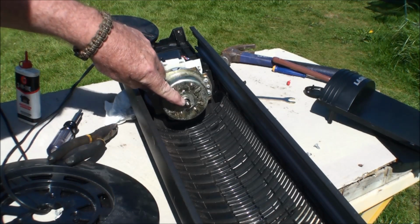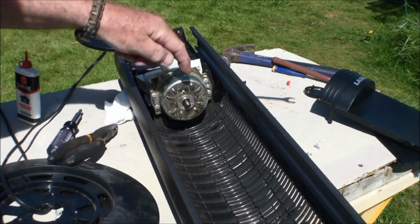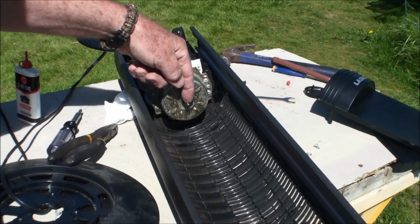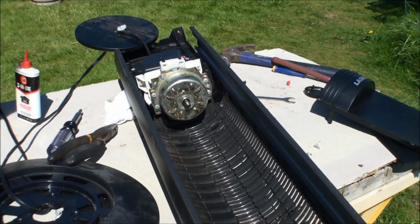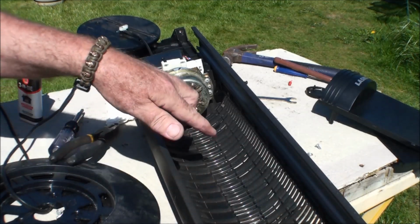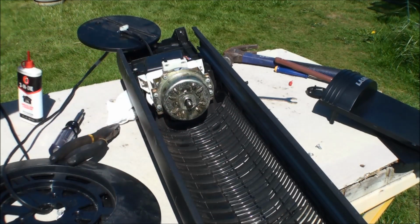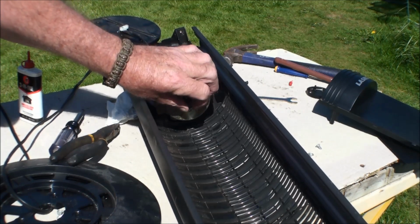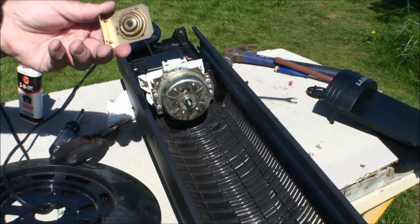And on here, the shaft has got a cutout on it. When you're installing the fan, you've got to make sure that the screw that's on the fan will be able to catch in there and snug it in there, and that locks it in so it'll stay twirling like it's supposed to. And I'll show you that as I'm putting it together, but for right now, I'm going to go ahead and take a brush and brush this inside because I didn't take this in the house. It doesn't look that dirty, but you wouldn't believe what comes out of a fan after it's run for 1 or 2 years or more, until the motor wants to slow so far down that you think it's burned up. So anyway, I'm going to go ahead and brush that, clean this up, and I'll be back.